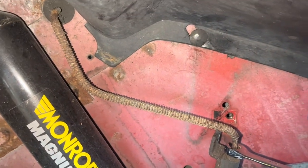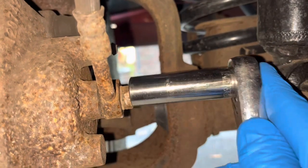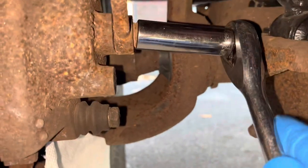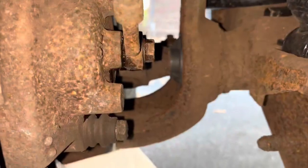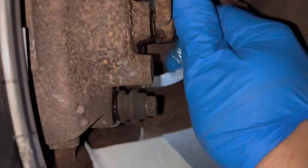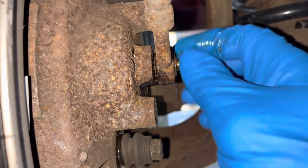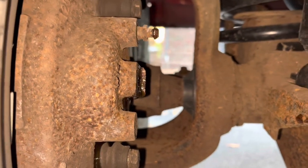I really don't have to disconnect that — I probably can just pull it straight out from the top. So what I may do is just disconnect the hose from the caliper and then pull it out from the top. The banjo bolt on the caliper is 14 millimeter, and that's all it took to get it going right there. Here comes the brake fluid — I've got a towel down here to catch it. These are the washers that I didn't have. I've got washers, I've got new banjo bolts now, and I hope they're going to be the right size.